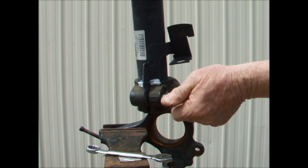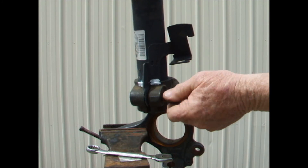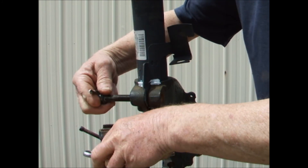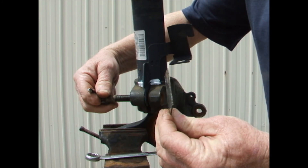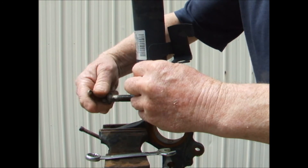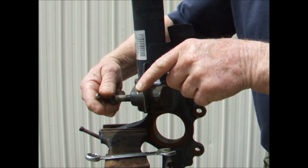Remove the bolt from its normal position and screw it into the threaded lug from the opposite direction. Place a thin piece of stainless steel between the tab on the strut/shocker and the unthreaded steering knuckle lug. Screw the bolt in until it strikes the stainless steel.